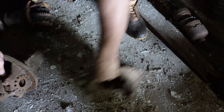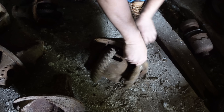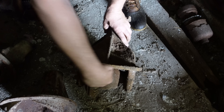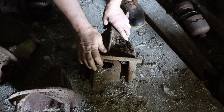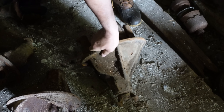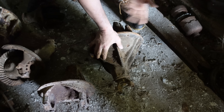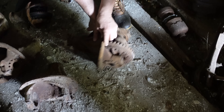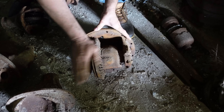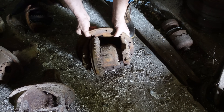Oldsmobile went from size to size — I think it was '58 when this monster Oldsmobile came out. When you find these things with a Posi — not here, this is an open diff. These things were big with drag racers. If you read Hot Rod or Car Craft, you know Don Garlits — they say he used an old Pontiac rear axle. This is what they're talking about. Big ring gear, I think it's nine, nine and a quarter inch diameter. Pretty big stuff. Strong, especially with the Eaton limited slip. Very, very cool and rare.